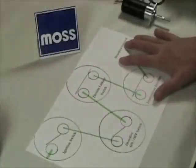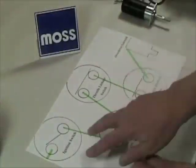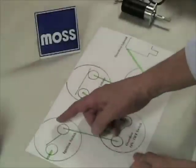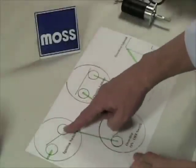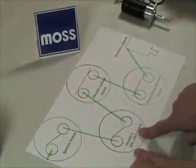We have here a map of how the electricity flows to feed the overdrive solenoid in your car. We have the ignition switch — power goes into it, and when the switch is set and ready to go, power runs to various things in the car, amongst those the overdrive off/on switch in your cockpit.